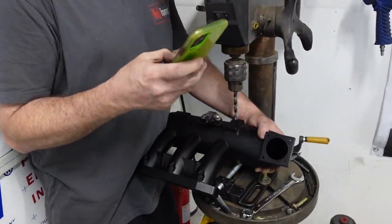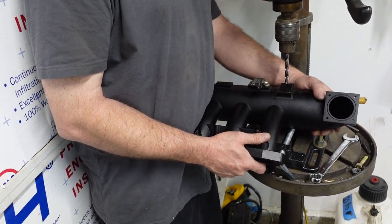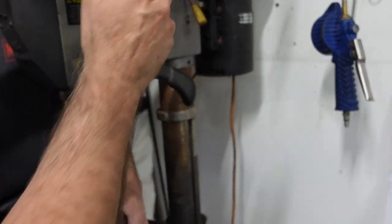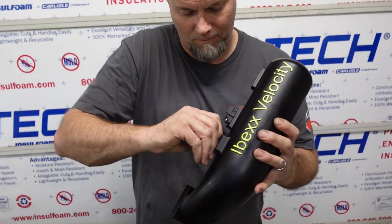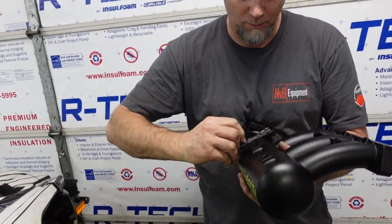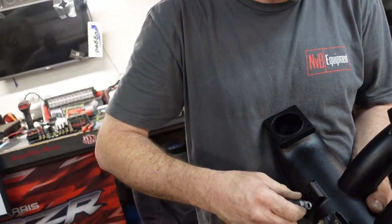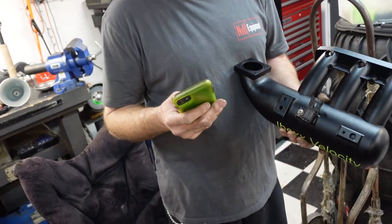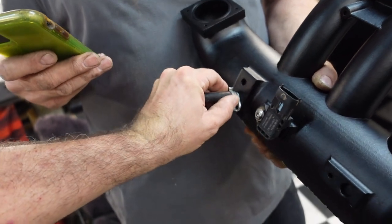So we're working on this brand new intake — this one with the green on it. The deal is we're gonna screw it up right now. We drilled a hole in this brand new intake with the drill press, and then we're gonna clean that edge up. Here comes the big moment — does it fit? So here's the deal: this is your boost reference. The intake had a through hole but it was not three-eighths, and this is three-eighths. Now it fits.